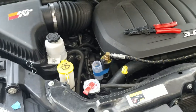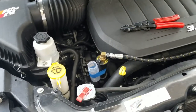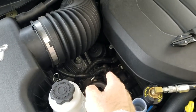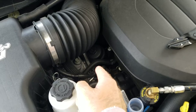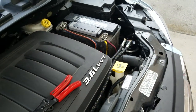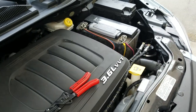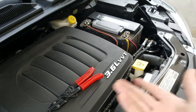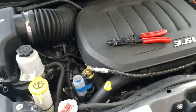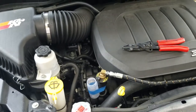Regardless of what the analysis says — even if they tell me to keep running it, as they have so far — I will be changing the regular oil filter and also the bypass filter. Changing the bypass filter will take about a quart to refill, so it'll get a little "tetanus shot" of fresh oil. Now I'm going to pause and get the sample.